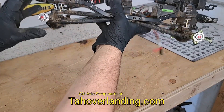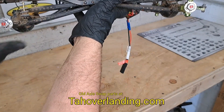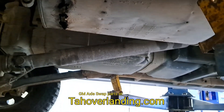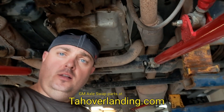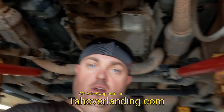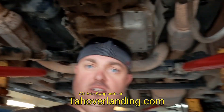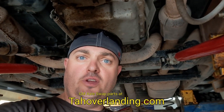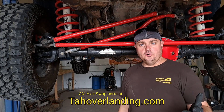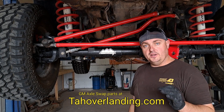On a full-size vehicle like a Tahoe, Suburban, or Silverado, you have stuff that needs to work — fuel tanks and such. It's even worse up front: oil pan, catalytic converter, exhaust, cross members. You can't run a triangulated four link on the front of a vehicle without costing 6, 8, or 10 inches of travel. A double-triangulated suspension doesn't need a panhard or track bar, meaning as it goes up and down it stays centered — and that is actually bad on the front of a vehicle.